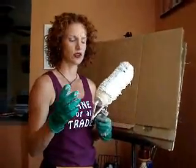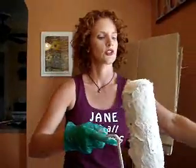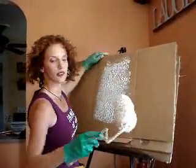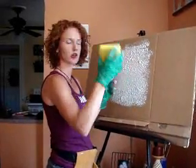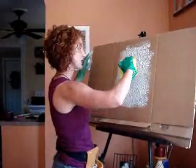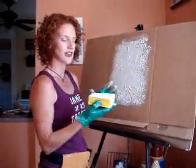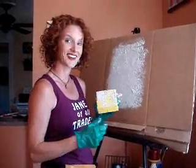Another technique is called sunburst or swirl. You're going to need a roller — maybe a half inch to three-eighths inch nap, depending on the thickness you want. They have recycled ones now, 100% recycled fiber. You'll probably have to spread the plaster on first with a putty knife, then roll it on the wall. You want it really thick on there, so don't be scared to use a lot. Safety goggles might be good because it's going to get everywhere. Then take a sponge — a little bit wet, but not too wet or it'll take off too much plaster — and just spin it to make a swirl. You can make all different sizes. After a while it'll compound, so rinse it a little. Take it different ways — like a heart, however style you want. It'll look great. And here's how the finished product should look. Awesome.